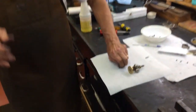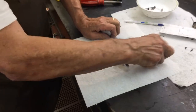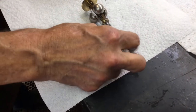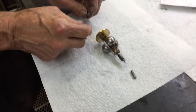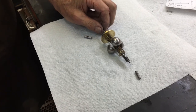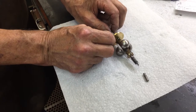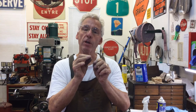The other thing I'm going to show you about this: on a Victor machine, the rear of the governor, here with the gear, has the bearing with the notch in it. And when you set the spacing on them, you set the spacing with the front bearing right here. This is the one you move in and out to adjust the play on the governor. So that bearing goes into the casting — you want to make sure that bearing slides in and out easily so you can adjust that little bit of play in the governor so it'll run.